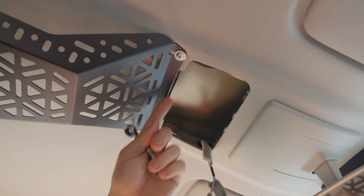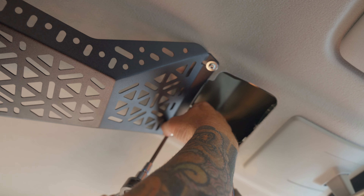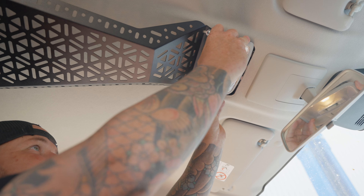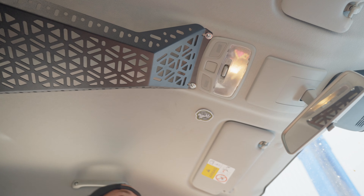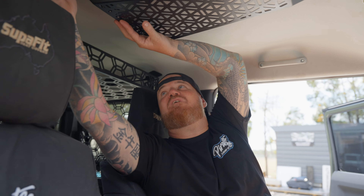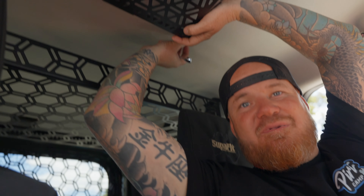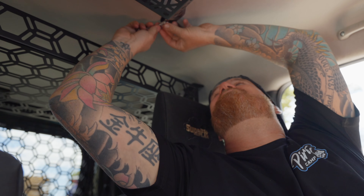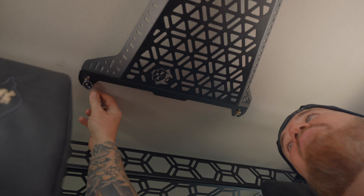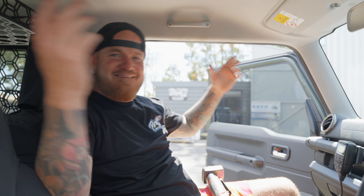You need to push this back far enough so the light will actually go back in - it's just got a little bit of a radius there. Perfect. Now the light goes back in - look at that, we've done it! Now back here I'm not actually sure what bolts were supplied, but it'll either be a hex head needing a 10mm spanner or an Allen key head needing a 4mm Allen key. Do these ones up - don't go crazy cranking and strip it because you can pull it up through the headlining pretty easily. It needs to be firm. There we go - look at that. That's it, we are done.